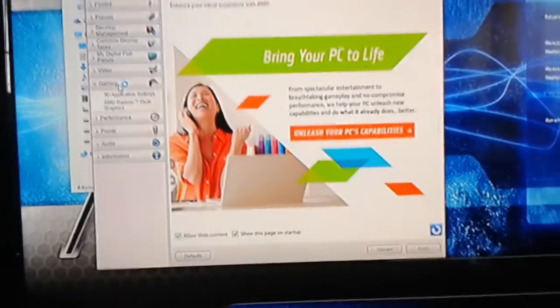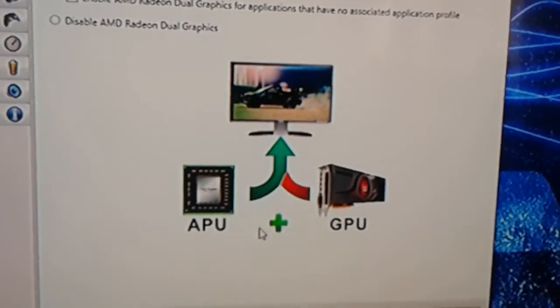I tend to benchmark games like Hitman Absolution, which is a very depth-of-field intensive game, and Tomb Raider remake — 1080p out of the box using just the AMD APU without dual graphics. In my Catalyst settings under the gaming option, I'm able to do dual graphics using the APU and GPU together. I recommend outputting through the motherboard, not through your graphics card, so you get the best quality. Though certain games are not able to be played in dual graphics mode.